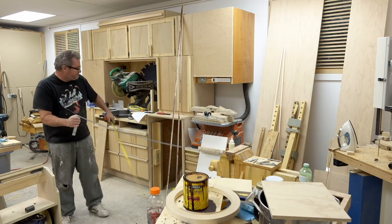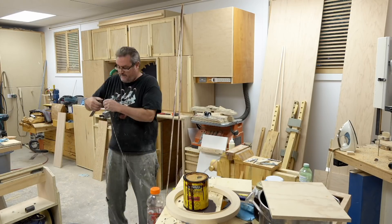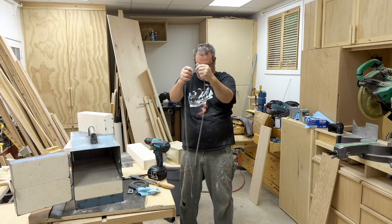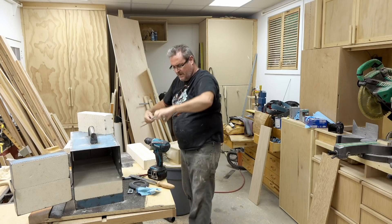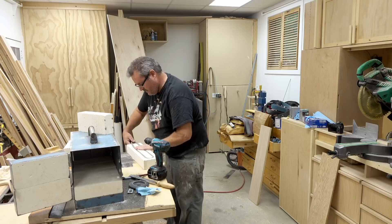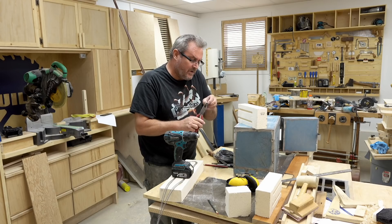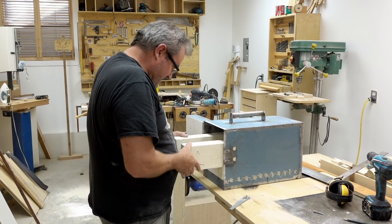Pull, but don't come out. I don't want to go too far — that's the thing I want to avoid. And I'm pretty sure that's it now. I'm going to start with the round part and try to make that even, then put it in here. What I need to do before anything else is make some staples to hold this in. To make the staples I'm just cutting pieces of the element wire — you have to use that; if you use regular steel wire it will melt. Now's the time to get it into here.